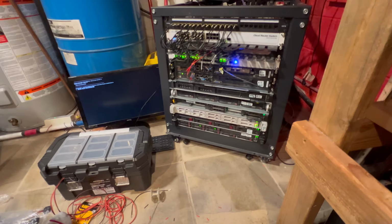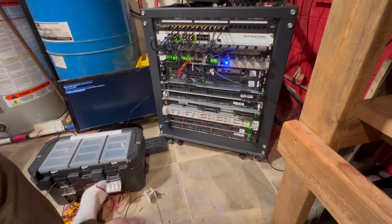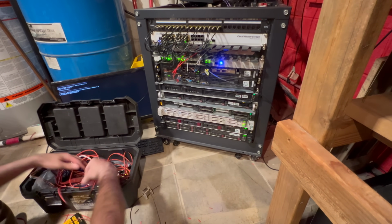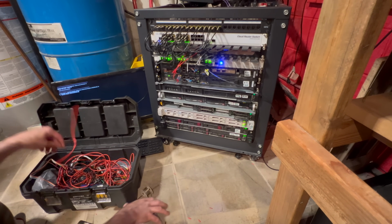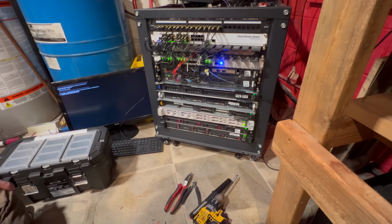Him to a point where I can turn them on. Let's go ahead and push that over there, power it up, make sure it doesn't beep at me or complain. Dell's pretty good about shutting the server down if anything's funky on the power side. I've done a few of these. And you'll know when it works because the Dell will basically fan power up, and if it continues without the green light shutting off here, you're in good shape. What it's doing right now is a system check. It's powering up, and we are good.